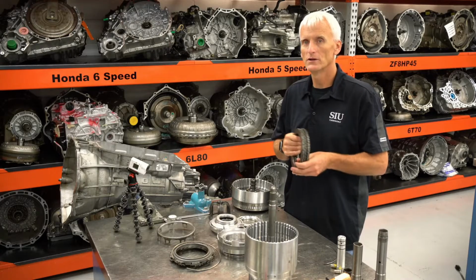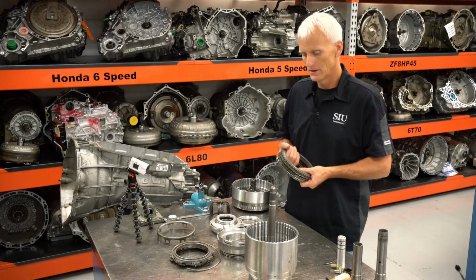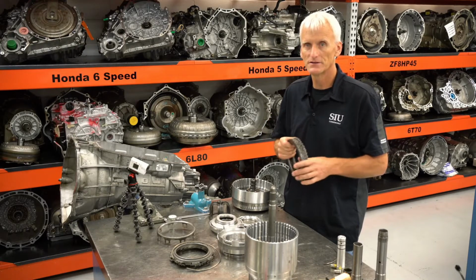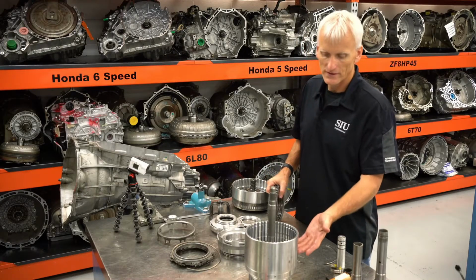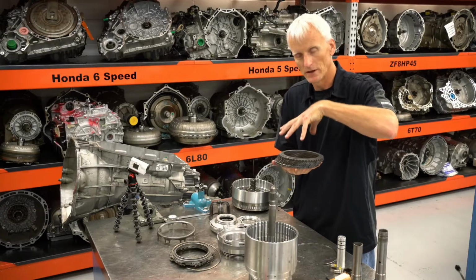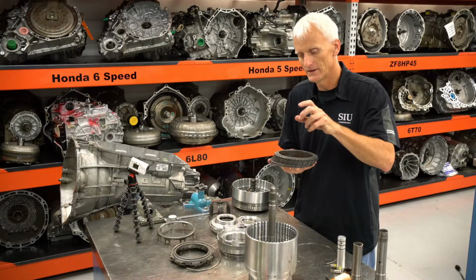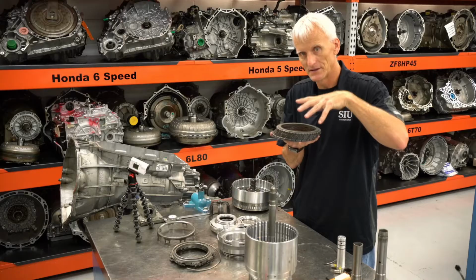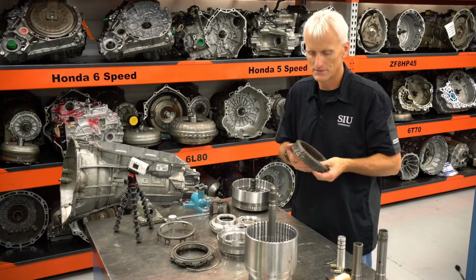And then we're going to put new clutches in wet and do the clearance checks and see how close they come to each other. The reason I'm doing that is that the process of checking the clearance is kind of unique in this transmission. As we've talked about before, you build it up, put a load gauge on and put a certain amount of force down on this clutch, zero your dial indicator, remove the load, stroke the piston, reapply the load, and then measure your overall clearance.